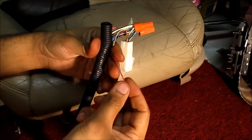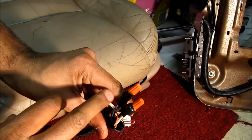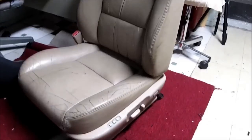This red wire with the green stripe I'm going to leave disconnected — it goes to the door switch. So here's my electrical connection: the seatbelt, the positive, and the negative. It's not too permanent but again it's just for testing. This is the finished seat ready to be put in the car.